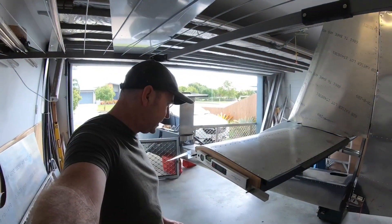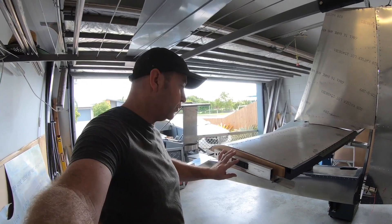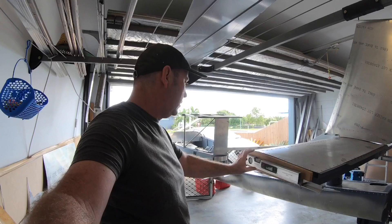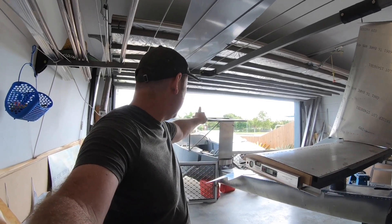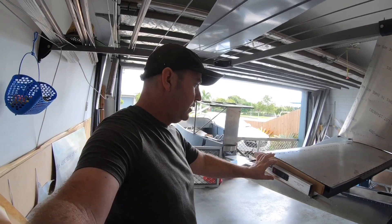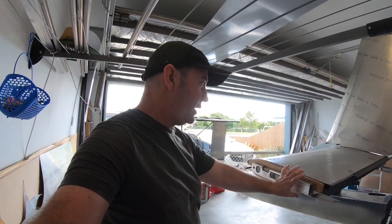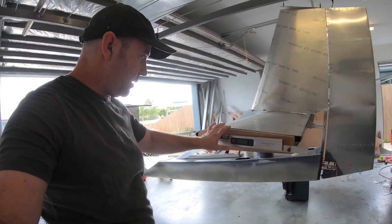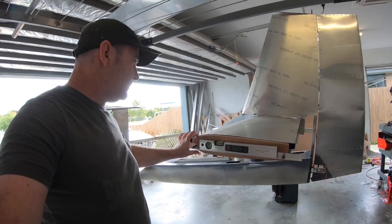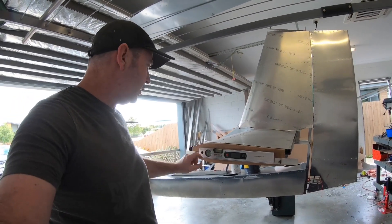What I've done here is I've got a digital level, which makes it really nice and simple to set up the angle. I've picked my level reference line, which is the top of the cabin frame there, and zeroed it to zero on there. This here is the template that I actually made the horizontal stabilizer out of, and all I've done is fix this to the end so it's exactly in line with the horizontal stabilizer.